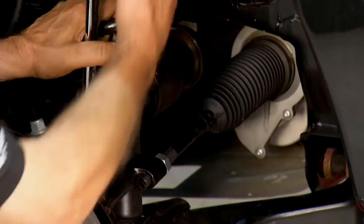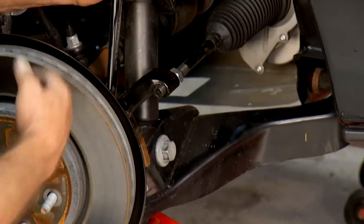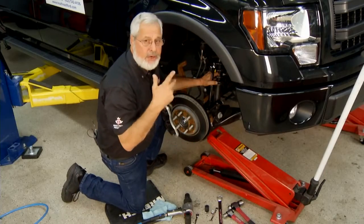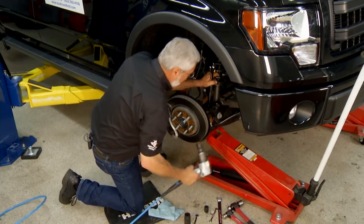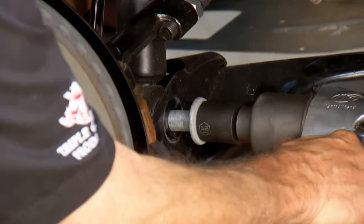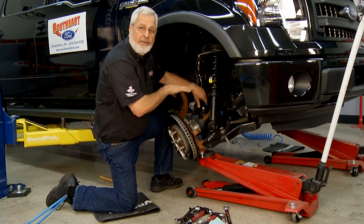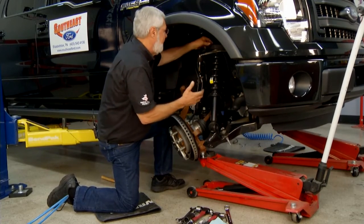The next step: there's a large bolt that goes through and secures the strut to the lower control arm. Take that off, then take the two bolts that go through the frame holding the upper control arm, then three more bolts on top of the strut mount, and the strut assembly comes out. Also release some tension on the link from the anti-roll sway bar and get the tie rod ends out of the way — it's all in the instructions, pretty simple.